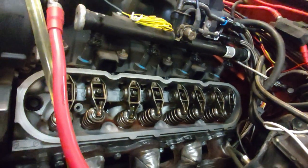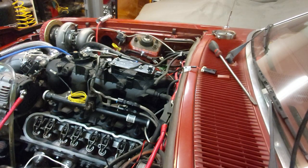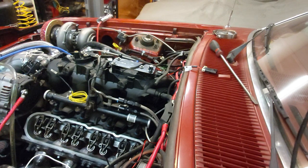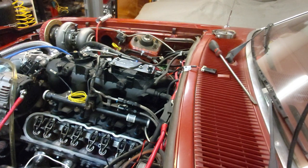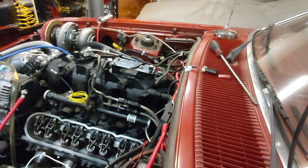As you can see here, there's the oil coming out of the rockers. That's all I wanted to do — just see if we can get some oil up to the rockers. Now we know we've got oil at the crankshaft and everything is good. I just wanted to show you the oil coming out of the rockers — hopefully you can see this. It's a messy setup. We've got our drill pump turning and the camera should pick up the oil coming out of the rocker arm, down the push rods and down the rockers. It's coming down one of them there. We've got about 20 psi oil pressure on our gauge.